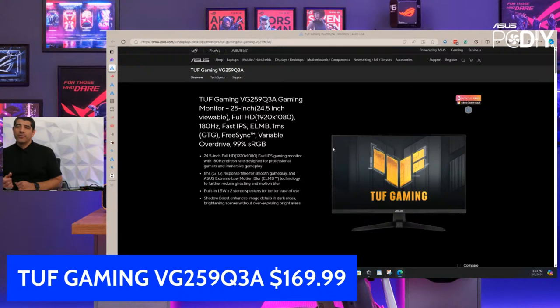If you're not familiar with variable overdrive, this just helps to mean that there's technology that helps to manage the tuning of the monitor across the refresh rate range. Because, of course, when you're playing a game, you can't necessarily always guarantee that your game output, your FPS, is going to be at 180 frames a second, right? So if you're going to have a variable refresh rate, you actually want your monitor to hopefully have variable overdrive technology, which means it's trying to make an adjustment to keep the motion clarity performance consistent, whether you're going to be at like 120, 140, 160, or 180.